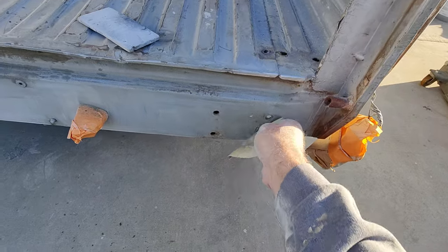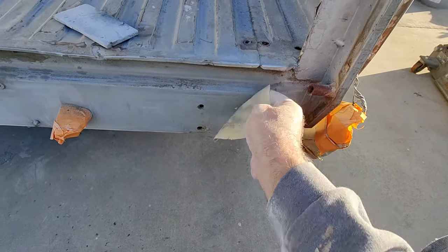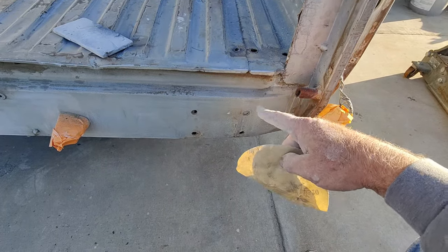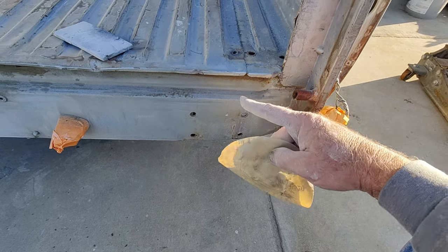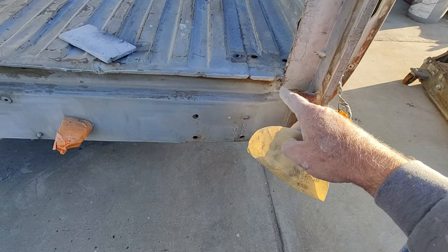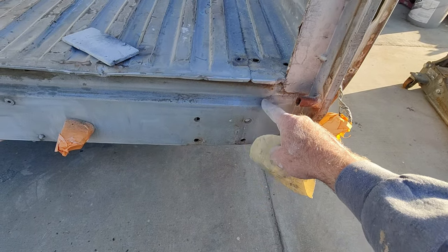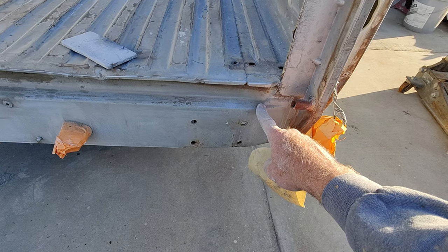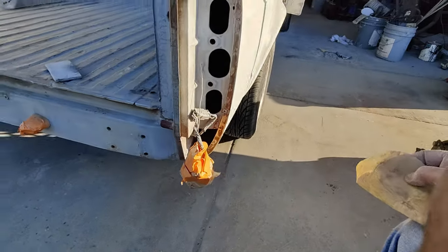And then you put a couple of coats, a little bit more than a drop coat. I'll put one full coat of base over it because the color got really close. Then I'll have about four coats of base underneath my color, and then I'll shoot one coat of the regular color base on here, which I can easily do. I've got about a quart and a half of paint, so that's plenty. That's more than enough. This thing's tiny.